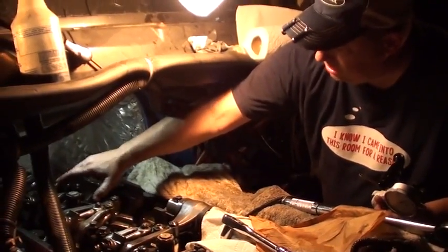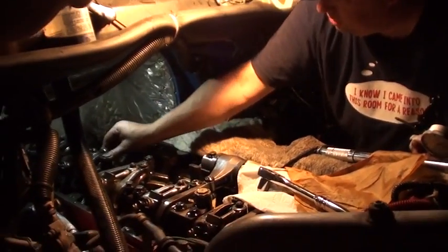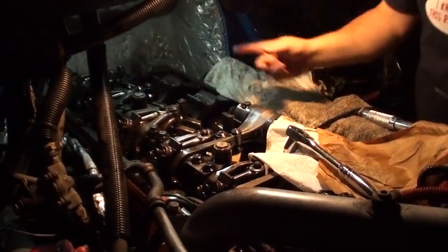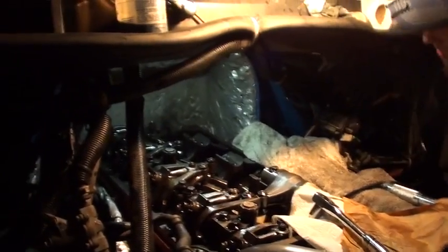You would do that on both sides if you really had a question or concern, but you can kind of feel that this one's a little narrow. Make sure the exhaust rocker is loose when you check that. That one's tight - you can see it starting through there when it's engaged. So we need to check that one again when we go to the overhead, but I'm sure it's going to be okay. It'll be within spec, pretty close. We'll do the overhead and check it again after it's done.